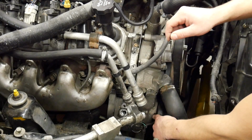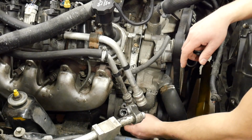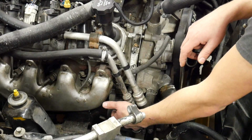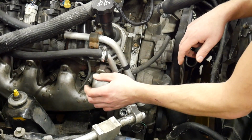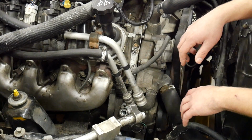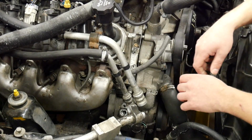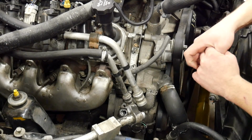It's a Sanden 1020. They make fittings. You can get them almost anywhere on the internet. They just bolt right on. They have their O-ring fittings. They have threaded ends on the other side. I'm going to have to put the low and high side fittings on those fittings and then adapt them to the Toyota lines. Shouldn't be too hard. The hardest part is going to be figuring out what I need.